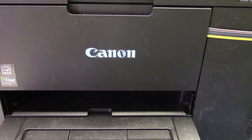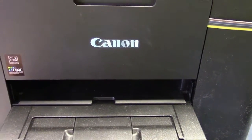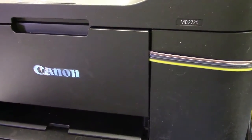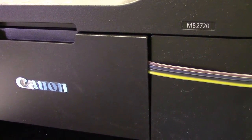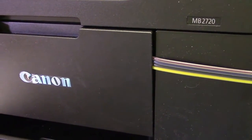The printhead is a thermal printhead. It heats up, boils ink, and fires it. So the more ink you put into it, actually, the longer the printhead runs. In our test lab, I've seen that time and time again. If we run it in best mode or even high quality, normal, it works the best. You run it in draft, you'll be buying another printhead.